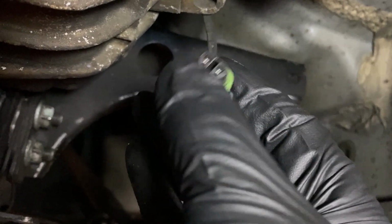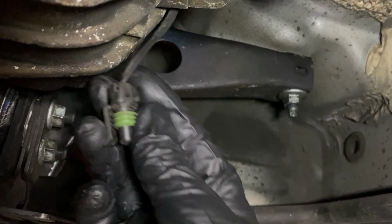Okay, my arch nemesis, the backup light switch. This almost killed me first time because of that tab. If you know that tab's there and you pull that out and lift it up, it's easy. But the way it's hidden from you when it's installed makes it tricky. And that's what you're plugging it into. It's easy to do now.